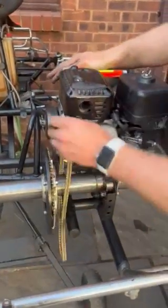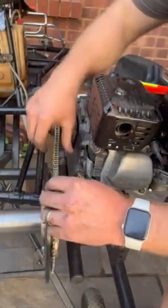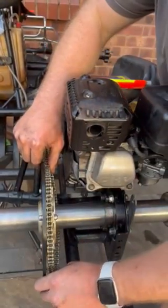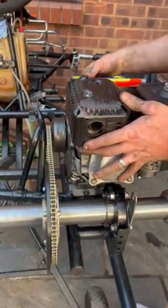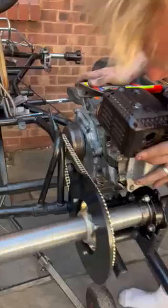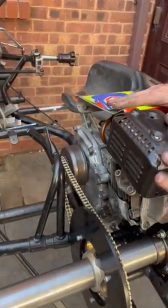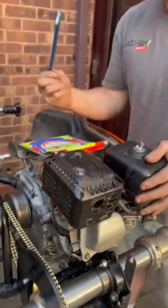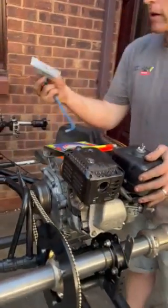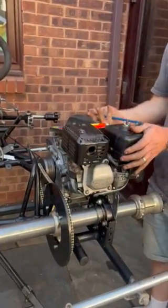Before we go to clamp, we'll run the chain around the front and rear sprocket. Always start the engine all the way back so that you've got plenty of room to move. Then what I normally do is just slide the engine forwards, like so, and have a little fiddle with the chain to make sure it's okay. Then you'll get underneath — you'll need an 8mm allen key — and apply it into those holes in the bolts and connect the engine down.